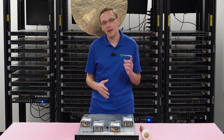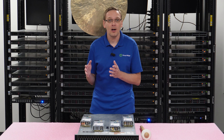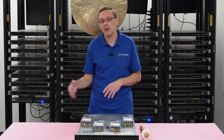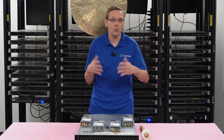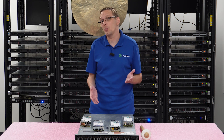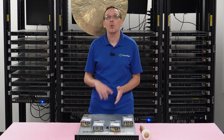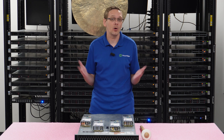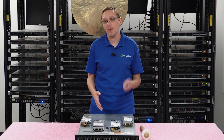Some warnings we recommend: make sure both power supplies are the same wattage. You can't put a 495 with a 750, or a 750 with an 1100 — it doesn't work. So if one fails and you need to replace it, make sure you match up the exact same wattage as the one you currently have. Otherwise it's going to throw issues and you won't be able to get redundancy. Just make sure you have two of the exact same power supplies.